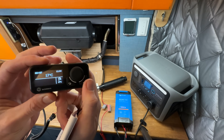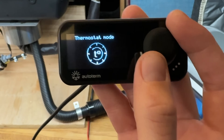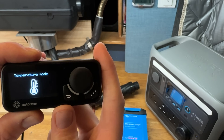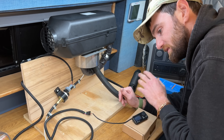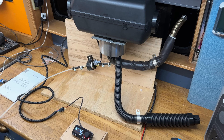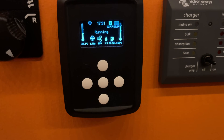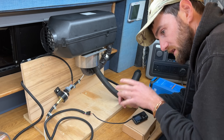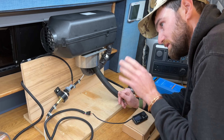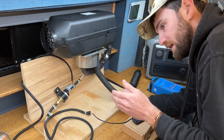Testing the heater on its automated modes. There are: temperature mode, power mode, heat and ventilation, and thermostat mode. Thermostat mode: gets to the target temperature, turns off, then re-ignites when temperature drops. Temperature mode: gets to the target temperature and tries to maintain it by varying pump speed and fan speed - opposed to Chinese diesel heater thermostat modes, which are a bit terrible. A four kilowatt diesel heater in a large van on low can still be too much heat, so it will turn off if it overshoots and turn back on as it cools.